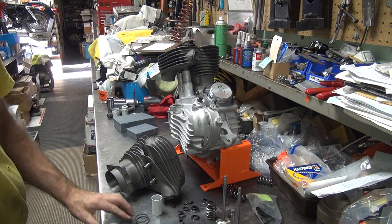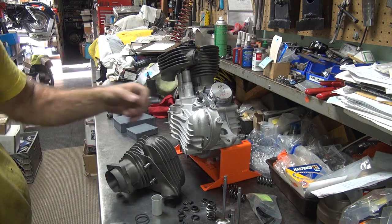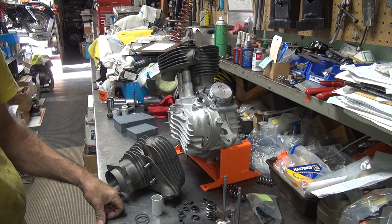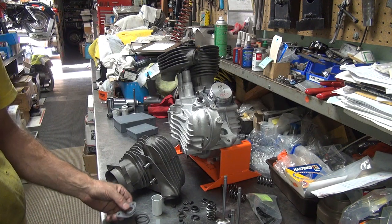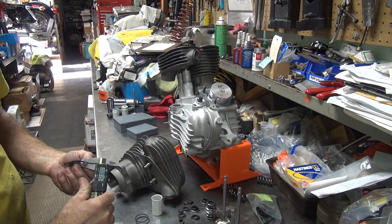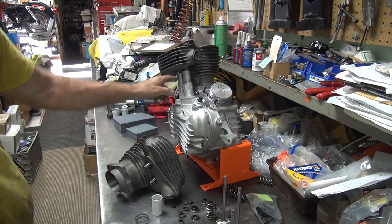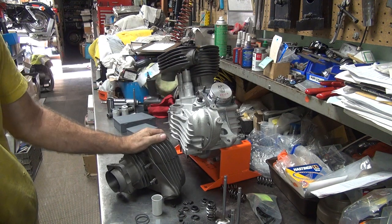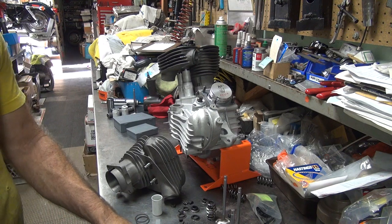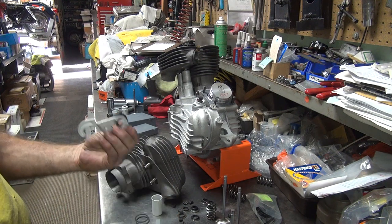So if you figure 60 thou is what the final will be, because we got a bunch of trash in here. I just measured 170. It's tight on this one. So you take off the difference, which was, 20? 60 minus. This is 80. Take off 60. 60 from 170 is 110. So if we make these things an eighth inch tall, we should be golden. And we're going to be 100 on this one because we had 100 and I have to go measure more accurately, but it's 145. No, left out one.